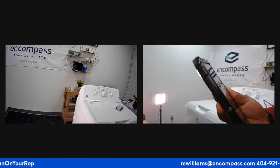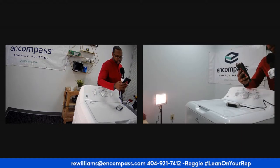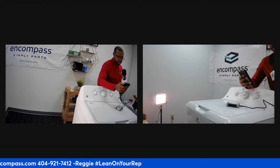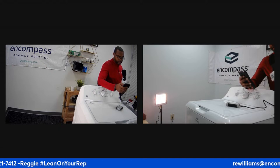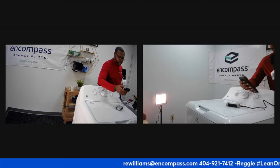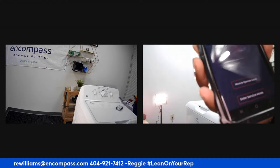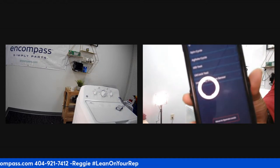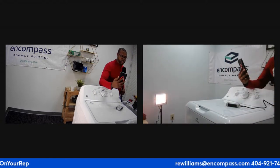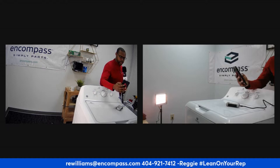We can look through cycle history, operate loads, diagnostic tests. So game changing. All right, so let's go in. We're gonna do diagnostic tests. Now, here's something important that you need to know. See that bottom one? It says enter service mode. That's the first thing you wanna do. This is the only thing that could be a little confusing, because on top it says spin cycle agitate, but the first thing you need to do is enter service mode.